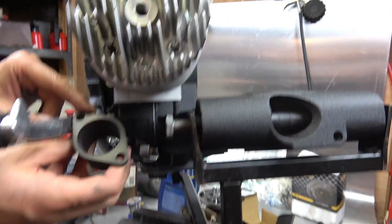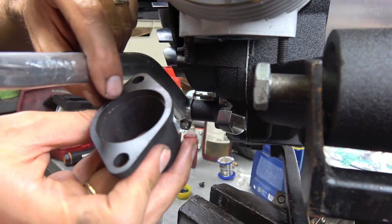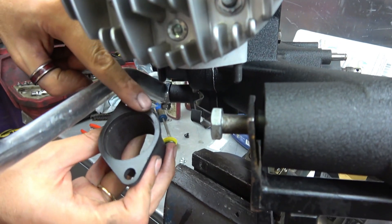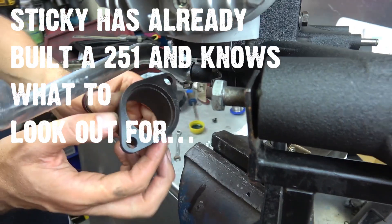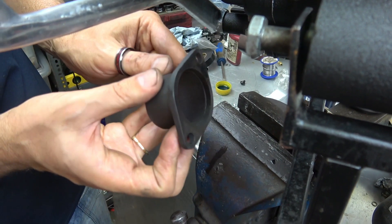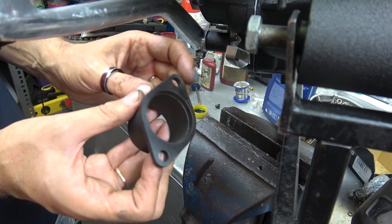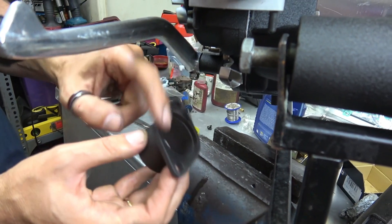One of the worst aspects of this exhaust design is that even though the hole is a bit smaller inside, there's so little gasket area around here. I've struggled before with this leaking, and the flange is quite small so that if you over-tighten it you end up with it not sealing very well. We'll just try silicone it and bolt it up, and if that doesn't work I'll have to put it on the linisher and flatten it.